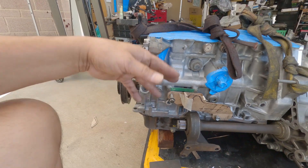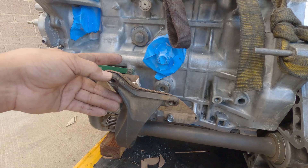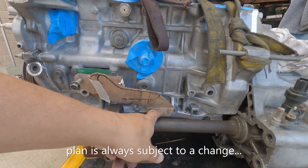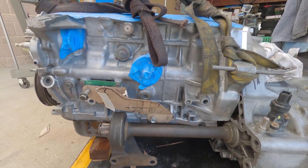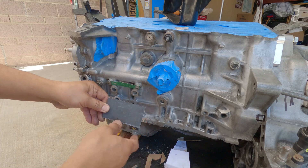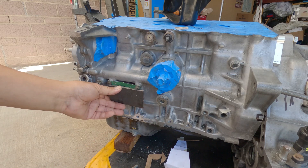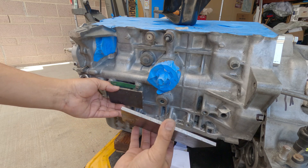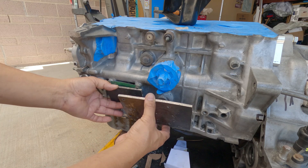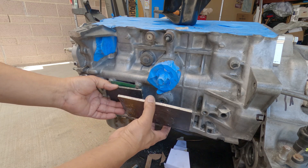Concept into reality. The final product may not be exactly like this, but it's still within the concept. I put a bend in here so I don't have to weld anything, and I'm going to use it on this quarter-inch. First thing I'll do is put some holes, bolt it on there, cut this to the desired form, bend it, make some holes, bolt it on there so it will be at an angle, and then make my bracing and weld it.